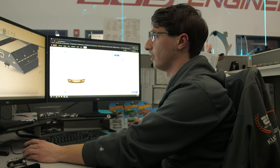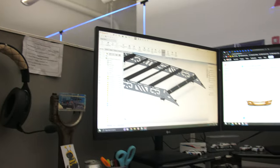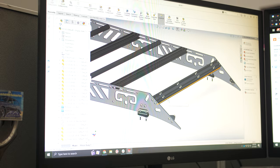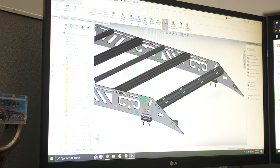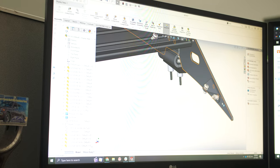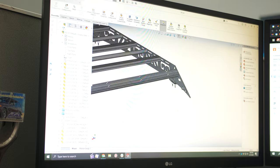And then in order to hold it all together, the fairings and the side panels, we're also utilizing 80-20 underneath the front and the rear fairings, held down with M6 hardware and T-nuts, and then these nice little corner brackets that are gonna be riv nutted and use nylon lock nuts to hold it to the fairings.